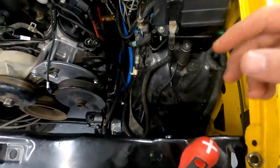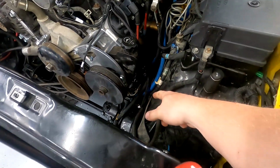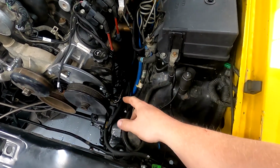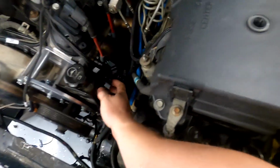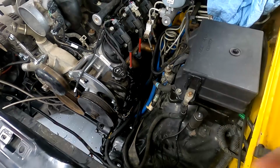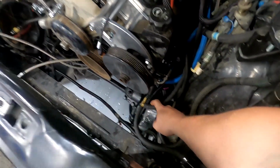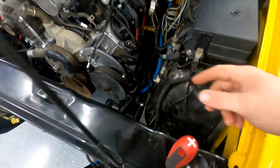Luckily or unluckily, whatever, the pressure line needs to be clocked 180 degrees. I don't know if I can do it where it's at, but we're gonna try. Worst case scenario, I can easily just get a 90 that comes out of the back of the pump and then go into a coupler. I think I even have some of that stuff laying around that will work, but either way, that is nice because that'll be easy to hook up. And then obviously I'll just run a line from the drain or return from here up to here. Very simple. That fixes that.